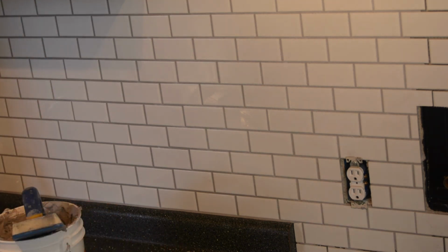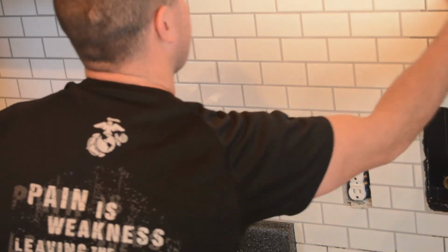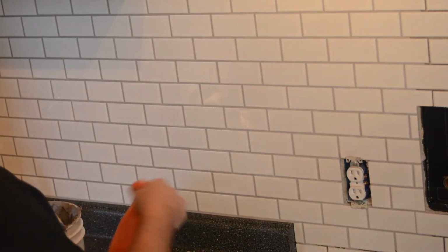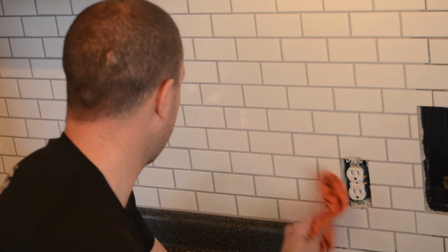So you just got to be careful with it. I'm going to rinse off my microfiber here, and we'll go through and wipe it down with the microfiber. Remember, the microfiber is just to get rid of that extra water, to dry it off and not leave a haze. There's still a lot of water on the surface. You're just coming in here to make sure there's no haze, and that water isn't drying with all that crap in it. So boom, come across, boom, rotate, over.